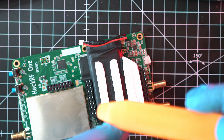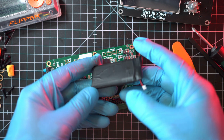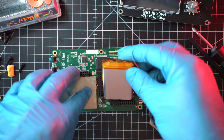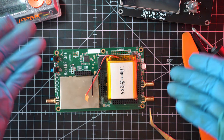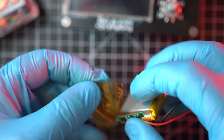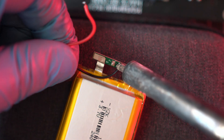This is my temporary battery — it is one cell from a MacBook battery. I used it while waiting for the new battery. The new battery sits here between these connectors, just like so. There is no right side up. The only thing needed is to replace the cables, as there is no connector on the new battery. I have to remove the kapton tape and desolder wires from the PCB, then desolder wires from the old battery, and solder wires with connectors to the new battery PCB.